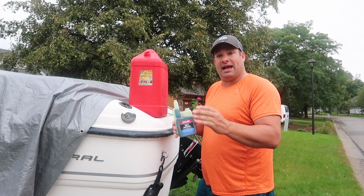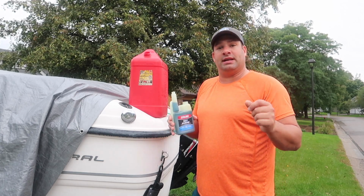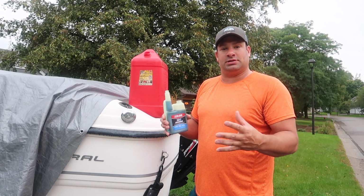Go check that out. And I have a link for changing your lower end fluid, which I recommend doing in the fall, because if you have water in there, it could burst your lower end and destroy the motor.